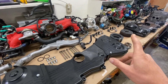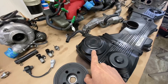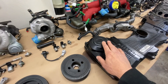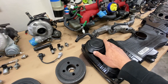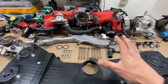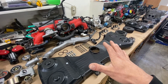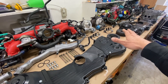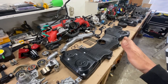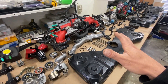One interesting side note: the US domestic model ECU doesn't have the ability to control the AVCS cam gears on the EJ207, which is a drawback. That means you won't be able to use the AVCS system from the EJ207 when running it with a US domestic EJ205 ECU, at least with a factory tune and completely factory setup. So for passing emissions and passing a BAR inspection, you basically have to forego using AVCS on your intake cams for the time being. But that's essentially what it takes to convert a JDM short block or long block to pass US emissions.